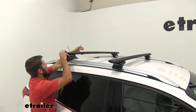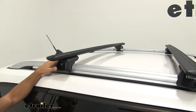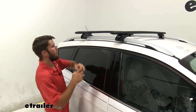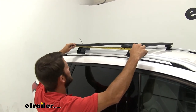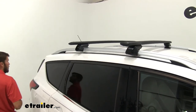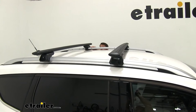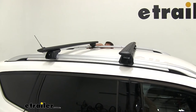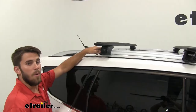We'll just get onto our raised side rail on the other side — same thing with this side. We're not going to do any tightening down yet; first we're going to measure our crossbar spread. We'll measure from the front of our back wing bar to the front of our front wing bar. There's no set measurement — just get a nice round number and make sure it's at least 24 inches. Most of the time I like to base it off of whatever accessory I might be using. Make sure you get it even on both sides, then we can start tightening it down.